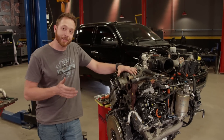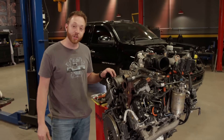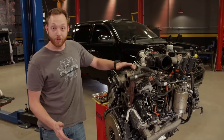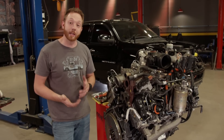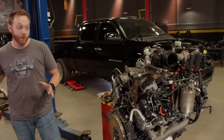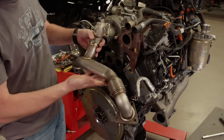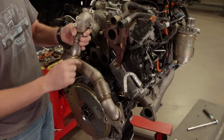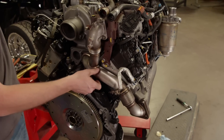Speaking of the turbo, it's technically part of the exhaust system. This is a Stealth 67 VGT we picked up from DuramaxTuner.com — it will support 800 horsepower, but it needs to be getting air from the exhaust manifold. PPE has exactly what we need because we also need to feed the EGR. This is their 50-state legal high-flow uppipe — it has a much larger diameter and much thicker wall thickness than stock, and bolts right up, keeping all these systems happy. The stock downpipe is quite restrictive because it has almost a sharp 90-degree bend as it exits the turbine. PPE also has their 3-inch stainless steel high-flow downpipe, which bolts right into place and has all the factory provisions, including a port for the ninth injector so we can fill that DPF with diesel during a regen.